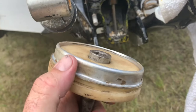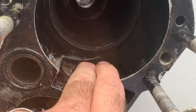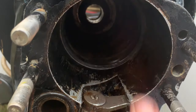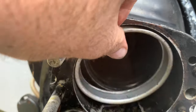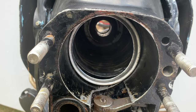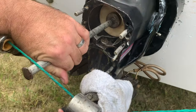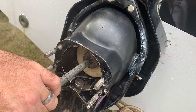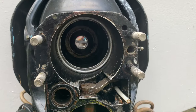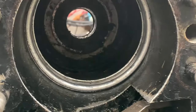All right, y'all, so we got the specialty tool, okay? That thing that just fell, that is the retaining ring for the main bellows. All right, the bearing in there. And then what I did, there's a little groove in here, and I pulled the bellows into place on that groove. And now we're gonna put this retaining ring right in there. And what it does is it puts pressure in there and holds that bellows into place. We just line it up straight. So you can see that's nice and flush in there, and that is retaining that bellows in place,